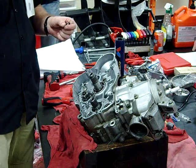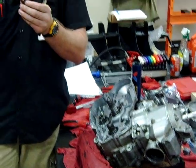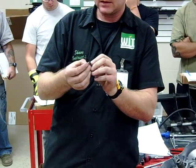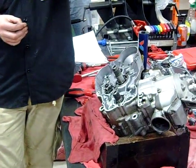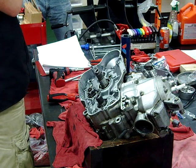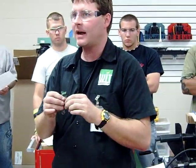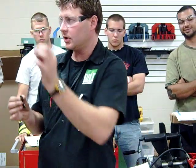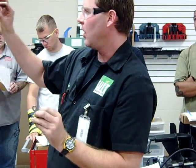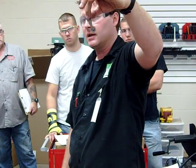This is the part that's so important about the detent — here's our little spring. What you have to know is: this was our outside washer that our nut went on. Do you see this little shim right here? This is what gets us into trouble. This is going against the aluminum case. If I lose this shim, what will happen is this will actually tighten down. If I don't have the shim in there, it's stuck — when I put my bolt and tighten against the case, it's going to lock up and be stuck in whatever gear, or it's going to be really super hard to shift. They're going to have to jump up and down on that lever trying to shift if you leave this little shim out. Sometimes the bushing will be made long enough that you wouldn't need this washer, but you can always test by simply moving it with your hand to see that it can move around fine.